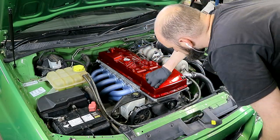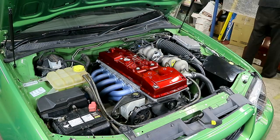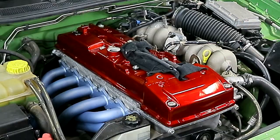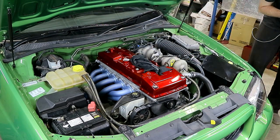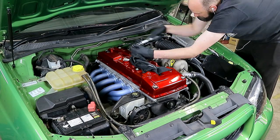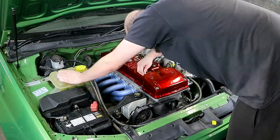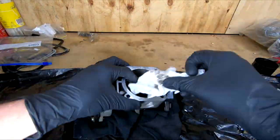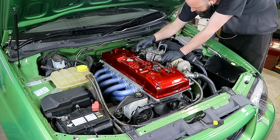A dab of medium thread locker is applied to all of these bolts when reinstalling. As a rule of thumb, I try to tighten bolts from the centre first and work my way out in both directions — this helps apply even force and avoid any warping. I did slip and chip a tiny bit of the paint, which will be covered with the coil cover. A torque wrench is recommended but not entirely necessary, with the two front bolts taking 13Nm and the rest 10Nm. If doing this without a torque wrench, be careful — this is very little force and it's easy to overdo it in the soft aluminium threads in the head. New cam phaser seals can then be pushed on — these bolts only need 7Nm, so absolutely no ugga duggas needed on any of these. Now would be a good chance to quickly clean out the throttle body with some carbon throttle body cleaner before replacing it with its new gasket.